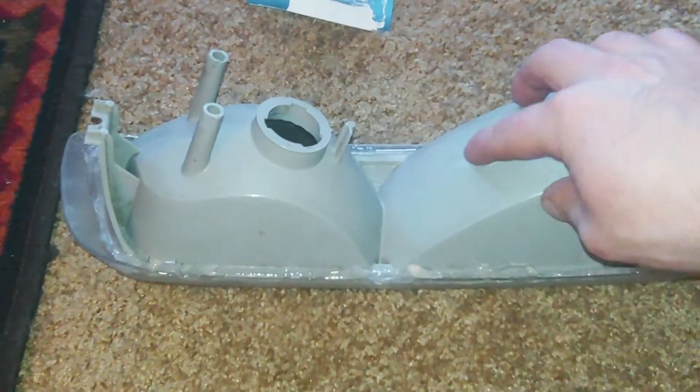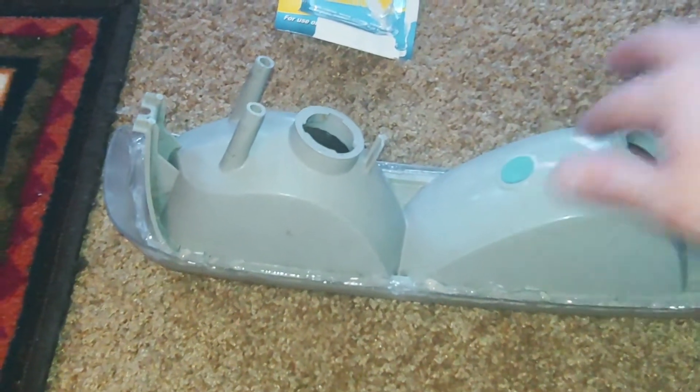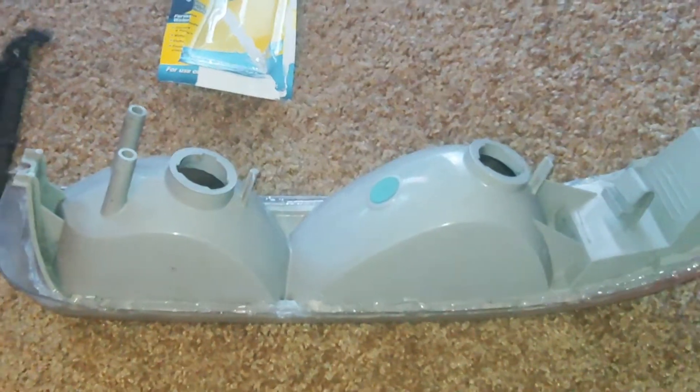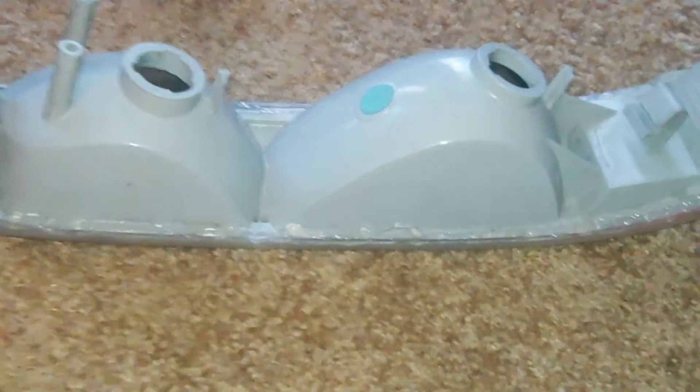There's like a piece of felt on the back of my housing. I'm going to go around it with some silicone, make sure that's sealing up as well. I just want to hit any parts on this housing that's going to leak water. You got to remember, this stuff's getting kicked up from the road while you're going 75, so just make sure it's sealed up real nice.